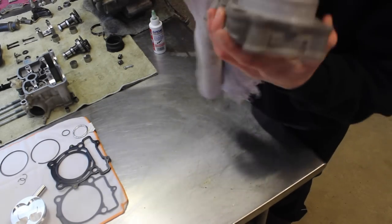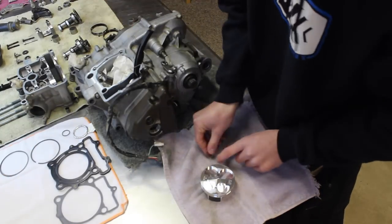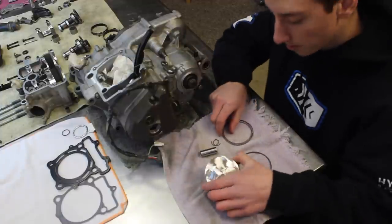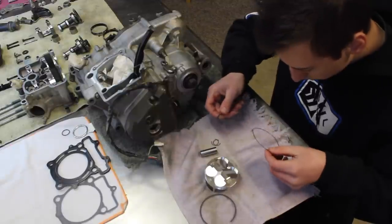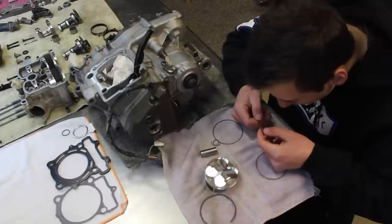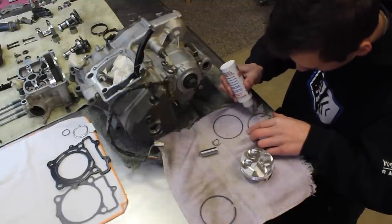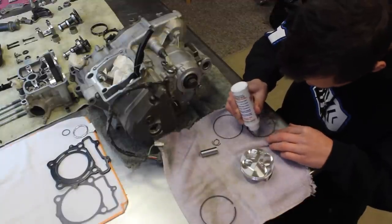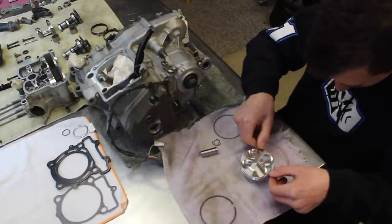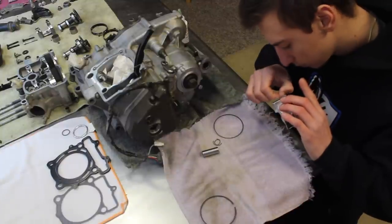After honing the cylinder, start installing the piston rings. You have one piston ring, the oil ring, and spacers. I like to start with the oil ring — most rings have a letter on them, make sure it's pointing up. Apply a light coat of assembly lube on the rings before installation to avoid a dry start on the first startup. Apply the oil ring one side at a time — it's pretty stretchy, but make sure it's not overlapping, as that will damage the cylinder.